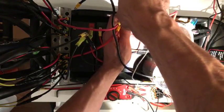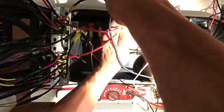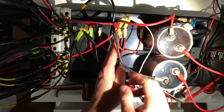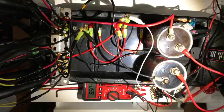Well, I just don't know why it wouldn't charge above 34. I don't either. I just want to see what's coming out of the alternators, to see if it's even putting out more than 34. That's the first thing to look at. I don't think those are meant to go that high, really. There's no regulator on them. They're just producing voltage without restriction. I don't know what they're made to make, but there's no voltage regulator on them.